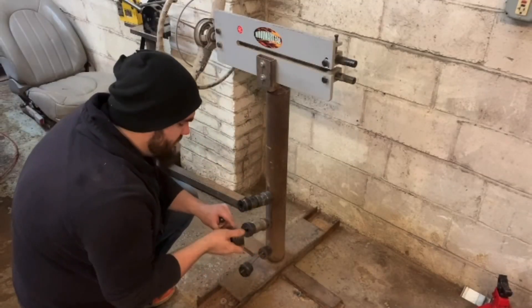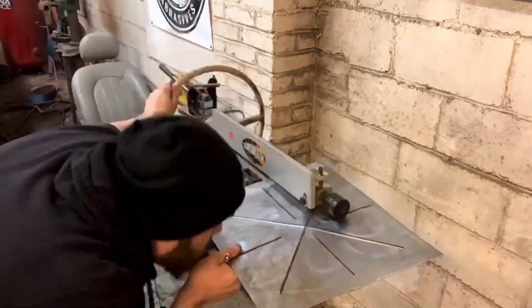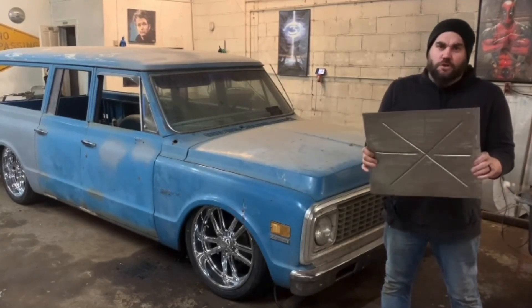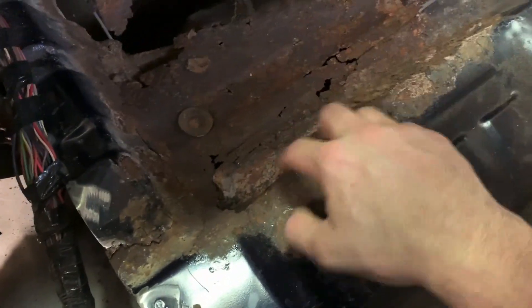I think I'm going to try and go with the smaller set I have and see how it looks. Boom — all done. I'm real happy with it, it's super strong and it looks pretty good. So we need to cut that giant hole out. Here is the patch panel I made the other day — it's not even big enough, so I'm going to have to add another piece here. I'm going to trace around it and then cut out all the rust. If you just put this on top of rust, the rust will just eat out your new piece. So let's cut all that out, then I'll get that piece in there and figure out the other piece I need to make.